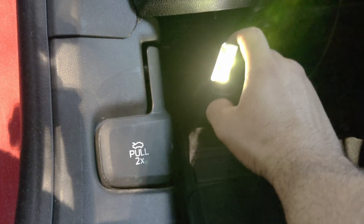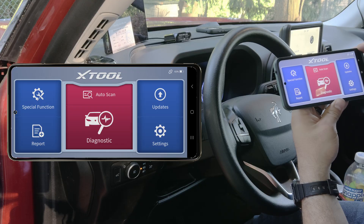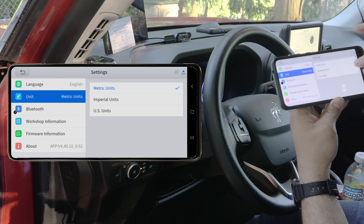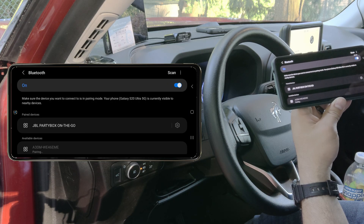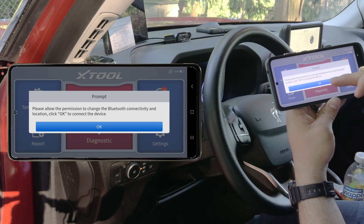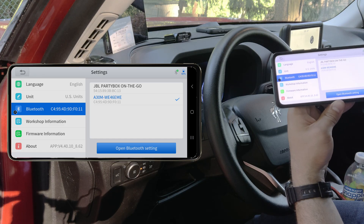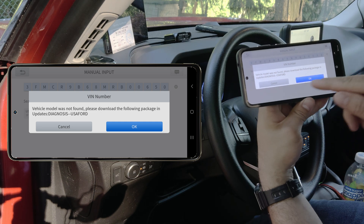Next, let's take a look at how to connect the A30M. Thanks to that ingenious built-in flashlight feature, we can easily locate the OBD2 port and plug it right in. Once connected, navigate to the settings where you can change your units and head over to your Bluetooth settings as well. You'll find the A30M in your available devices list, click Pair, and bounce back over to the app. Here you'll see a prompt that you'll want to hit OK to, and now we are paired with the actual scanner.